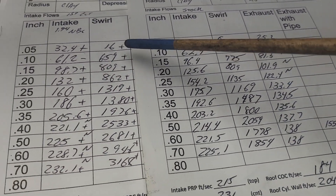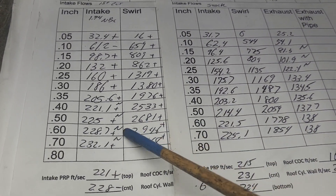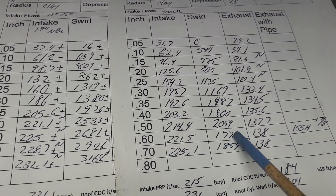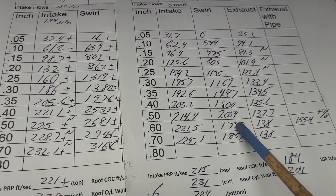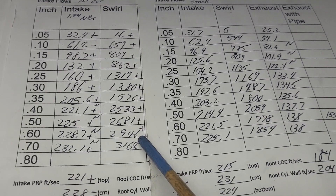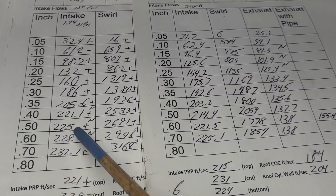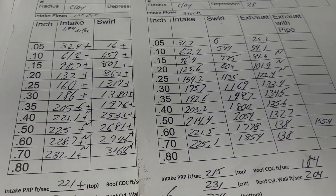Comparing our swirl numbers here to our swirl numbers here — our swirl went up everywhere. Between 500 and 600 we got 26, 29 — a little bit higher than I'd like, actually. Notice how much they went up from where they were — huge difference in swirl. Going up to 600, take a look at how much this one went up — wow, huge difference. And of course it has to do with the way the short side works. So as we fix this short side, I'm pretty sure we'll see these numbers go down. It'll be interesting to follow along.